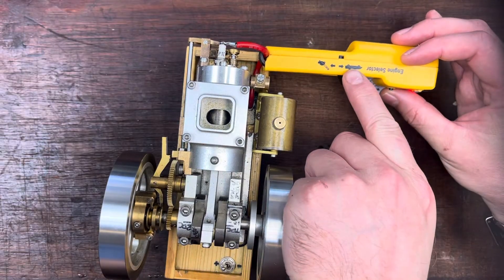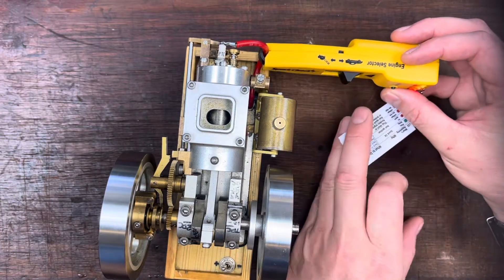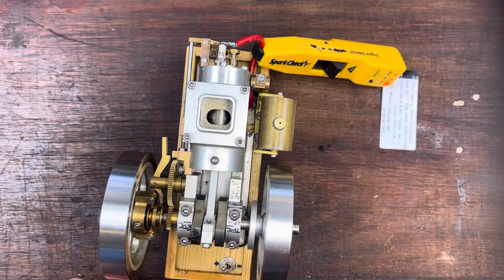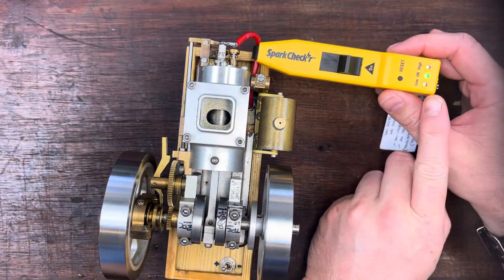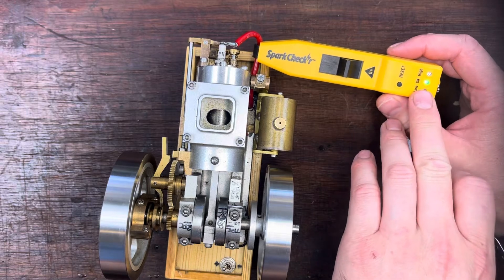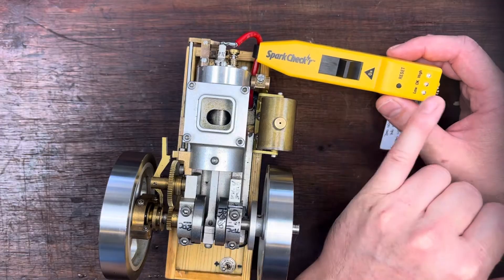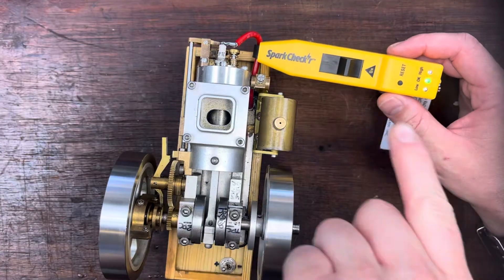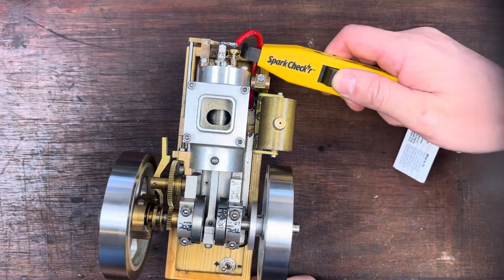On the side, you can select large engines like vehicles, or small engines like OPE. I've set it on the small setting. I'll talk about the settings and voltages in a second. Engine's on — I'll give it a flick. Have a look at the light, and it's telling me I've got spark. Obviously I know it's got spark, it was running, but proof of concept — it's green. The other delightful thing is that the light doesn't reset until you push it forward. So you can walk around the front of the mower and say, okay great, I've got good voltage, I've got a green light, I know I've got spark. I'm not fighting with the tester.